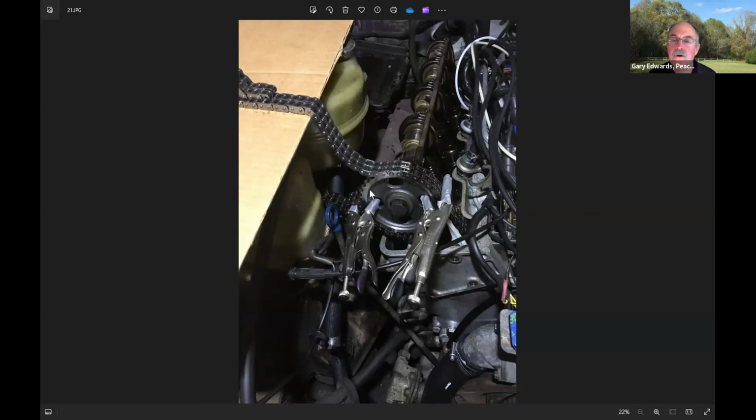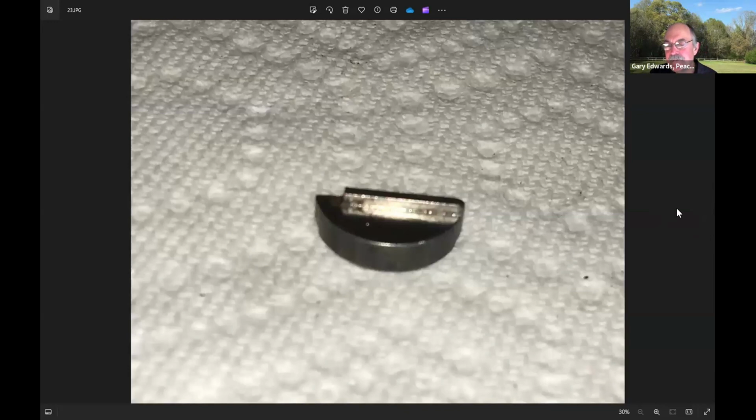When you've got all the new chain in there, you pull that master link, and this master link holds the chain back together, and you've got a new timing chain. But go measure chain stretch. When I did this measurement, I was very surprised to find that I had 9 degrees of stretch still. And that's a problem.